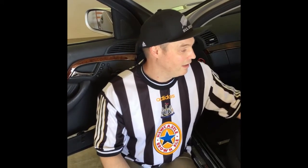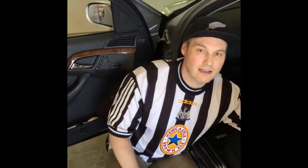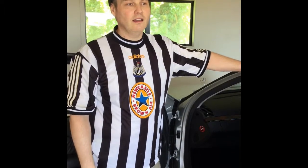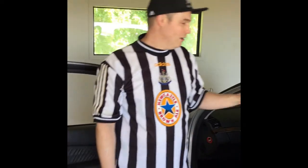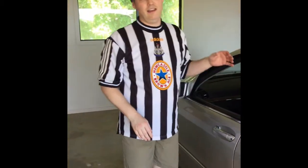What I learned is that apparently when you get these cars, people tend to just set these numbers on whatever number they want, 1, 2, 3, and they just leave them. But whatever airbag is in the seat cushion, over time they leak. I suspect what's happened with me is that for a long time I was parking undercover and the car was in shade. But for the last 2 weeks it's been parked outside in the sun. It's summer here in New Zealand. It's got hot, something's expanded or cracked a seal and that's now leaking. In 1 or 2 of these chairs the air was leaking out, which was causing the pump to go on.